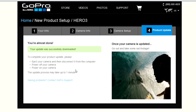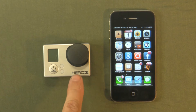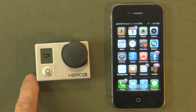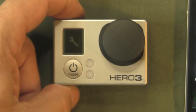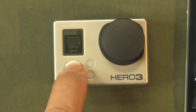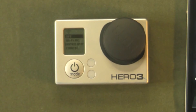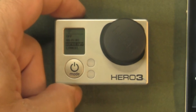We'll go to the next step over at the GoPro and the GoPro app. Now that we've updated our firmware on our Hero3, we're going to enable it to use the Wi-Fi app. Turn on your Hero3 and go to the settings menu — the little wrench — which is four taps. Hit the top button and go to the wireless controls menu, which is seven taps. Right now the Wi-Fi is off. Hit the button again and it gives us choices of off, Wi-Fi, remote control, GoPro app, or cancel. Go down to GoPro app and confirm.